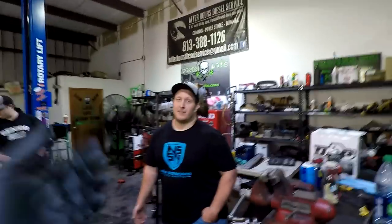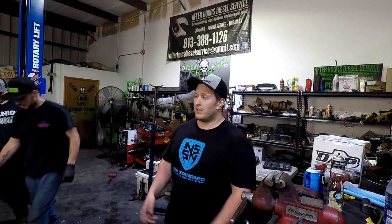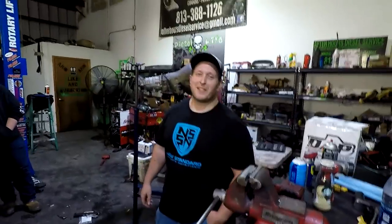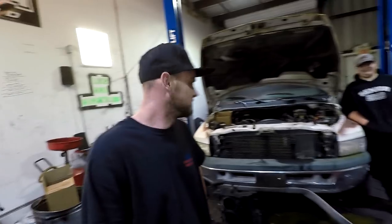So what are your plans with that truck? Got 150 horse injectors, a 64.5 68 SXE, which I've showed on the channel before. It's fresh, brand new in the box. So throw that on it, South Bend dual disc with the bigger input shaft. So it's gonna be ready to party. Probably a 550 wheel. Are we gonna do a burnout? Maybe. I hope so. A little clutch drop challenge. We got plenty of old tires, that's for sure.